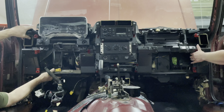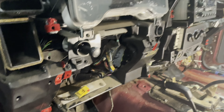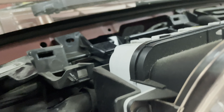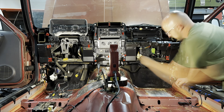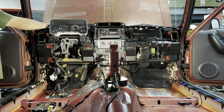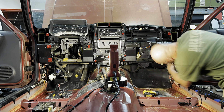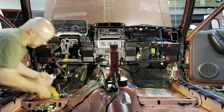We can pivot the dash up and then start these studs and these smaller bolts at the top. There's going to be one of these on each side — it's an M8 125 with a 13 millimeter head. Now that we've got the dash carrier back in, we'll go ahead and tighten all the bolts. Across the top there's going to be six — four bolts and two nuts with 10 millimeter heads. Then there's the two side bolts which are 13 millimeter, and a support bracket for the center that has four 13 millimeter bolts. Once we get all this tightened, we're ready to make electrical connections.